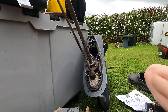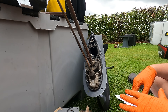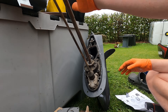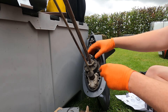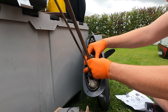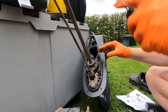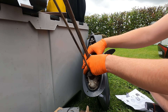Ideally I'd have this in a vice on a workbench, but I haven't got that today. For those who don't have one, this is the same approach — just rest it somewhere and don't put your weight on these shafts because they can bend. With the four bolts out we'll see if it'll break free. It's got a bit of resistance so I'm going to get a flat blade screwdriver and give it a helping hand just to break the seal.